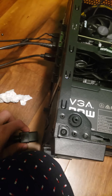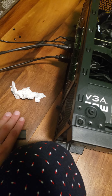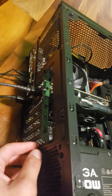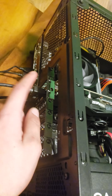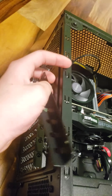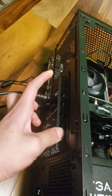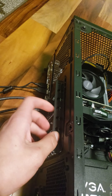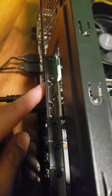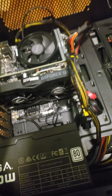The first thing you want to do is unplug your computer from the power supply. Then take off the bracket on the case — there are going to be two screws if you have the same case as me, though it varies. Then take off the two screws that hold your GPU to the motherboard.